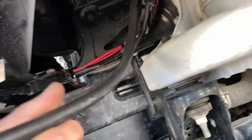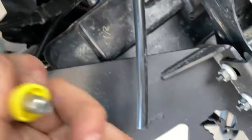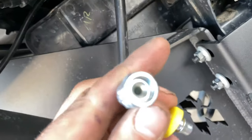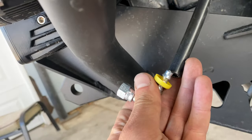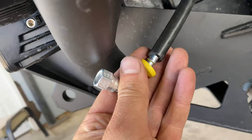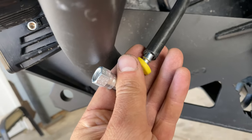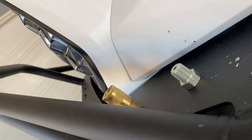So I got my air hose routed. I'm gonna be putting in, I think this is a compression style fitting. Anyway, it doesn't require any of the pipe sealant. Any fitting like that requires nothing. So don't put any of the thread sealant on it. Make sure you get your hose to length and then push your fitting on, because it takes some muscle. So do it where you're comfortable doing it. And then I'm gonna connect this, and then we'll put our air chuck on.